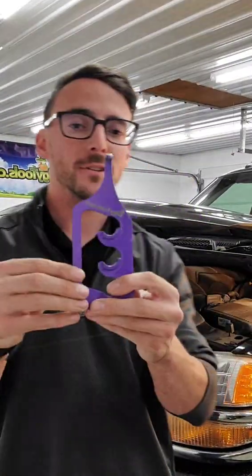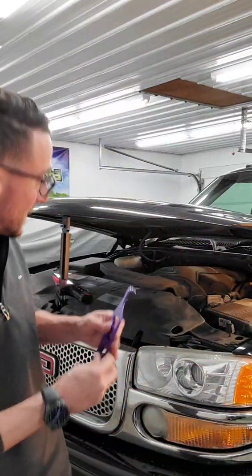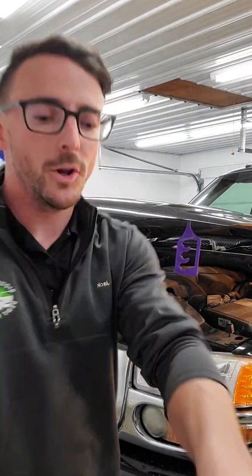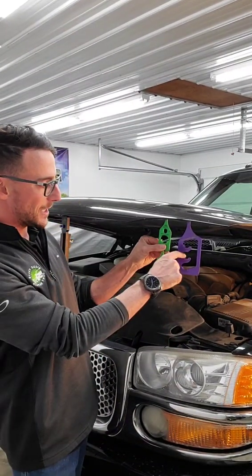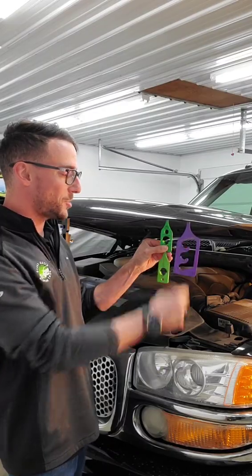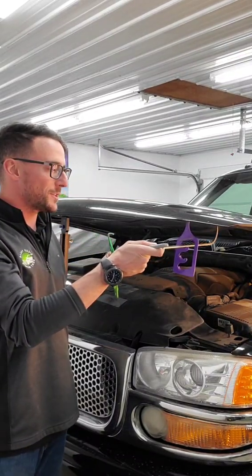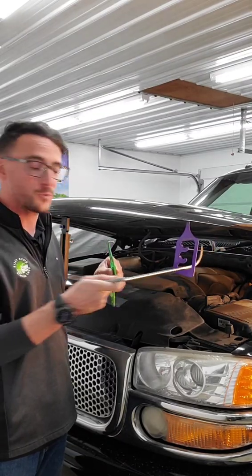This is another hanger that we use called the step hanger. What this allows us to do is the same thing, but with different points without having different hangers. No longer do I have to piece together two different ones, or maybe I need that little sweet spot right in the center. This allows you an instant change up. You could come in here, fix a dent with the top hole, and then go, for this next one I need to drop it down just a little bit. Okay, well, you've got another spot and another spot.